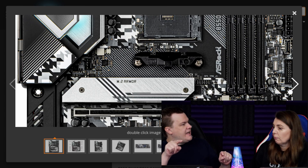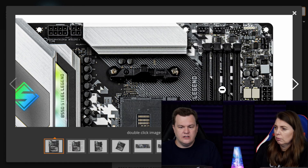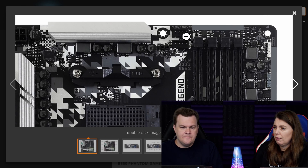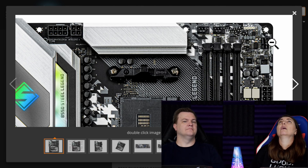And you remember how we had to do the funny cable management for the fan? This is the Micro ATX version — we didn't have enough fan headers. No fans. The full size has fan, fan, fan — that would have been so much easier. Because in our build we have two fans at the top of the case, and then the cooler has a fan, but the Micro ATX version only has two fan headers. You can get splitters, but the more you have in there, the more problems can go wrong.